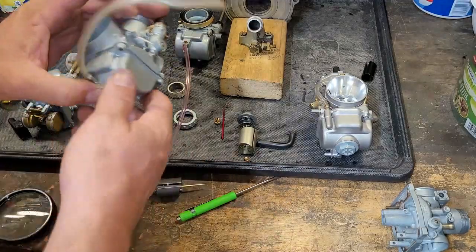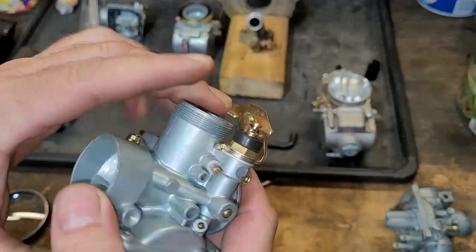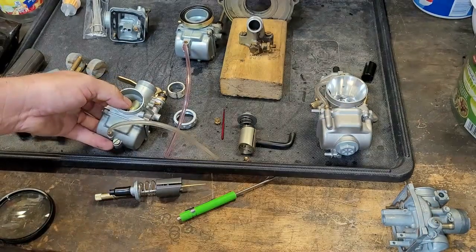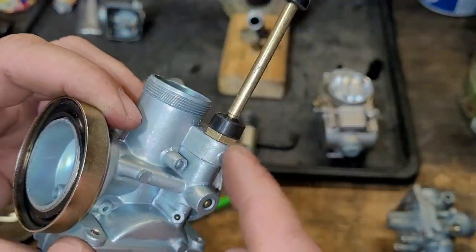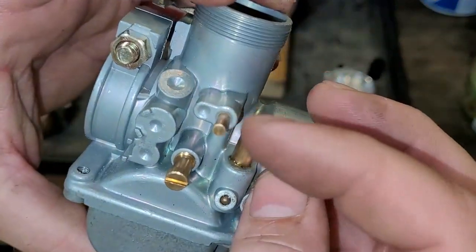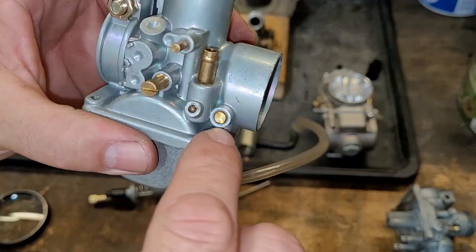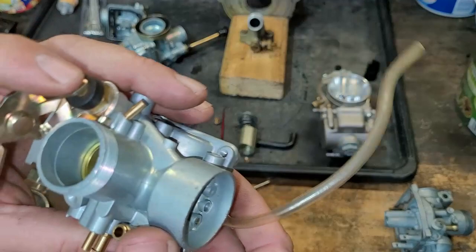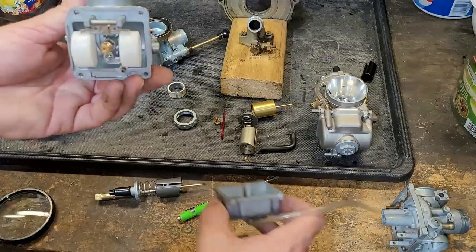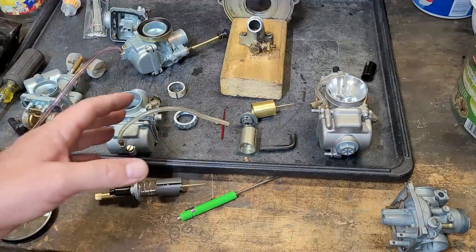Don't be intimidated — there's all kinds of carburetors out there. This is another style where it comes off the front clamp style in the back, but it has a different style choke. Here's the key: if you come across something like this, you can literally pull this choke out with a 12 millimeter wrench, and then you can add your old setup to it — it'll work right on, no problem. The vent is right here — this brass tube, that's where it vents out of. The idle speed screw adjustment is on the side. It's got floats and jets — these carburetors are all pretty close; you just have to take your time and look at what you're getting.